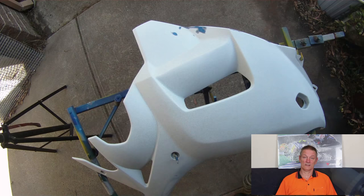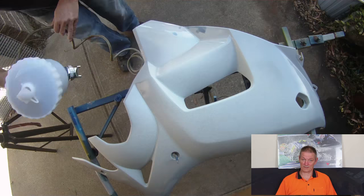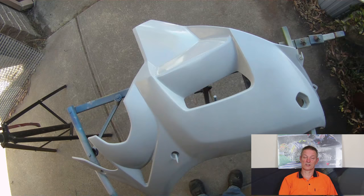When you do this kind of stuff, spray from slightly underneath and get all the edges. Make sure when you go around that you've got all the edges so that they're all nicely covered, because when these panels stand on their edge you will be able to see the original colour underneath them. So what I've done is I've put two coats on here with a flash period of about 15 minutes. Let it flash, take a break for about 15 minutes between coats. I've sped it up, so the two coats are completed in one short piece of film. This is now two coats complete.